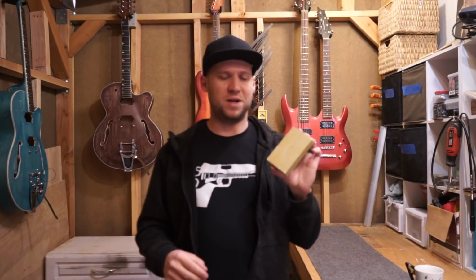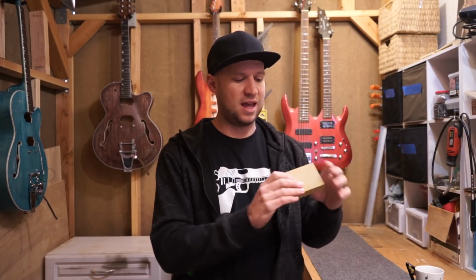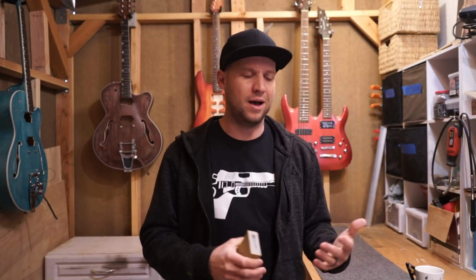Also, a product that I just recently came across that is super helpful are these sanding sponges. Again, these are made by 3M and they are the Sandblaster Pro brand, grade, level, whatever you want to call it. They're a little bit more expensive, but they are awesome because they flex as you're sanding. So you can use it to match the contours of the body a little bit better, and get into some of those hard to reach areas. I know obviously paper is flexible, but these seem to do a better job of evenly distributing the pressure while you're sanding. I only have them in 220. I'm gonna go back and buy them in 150 and 320 as well because I like them that much.